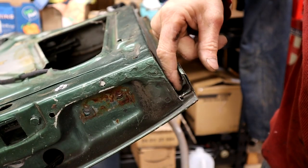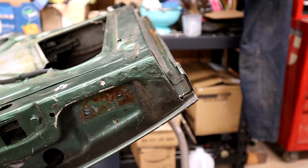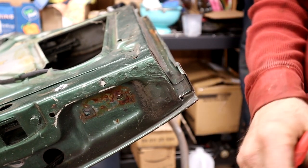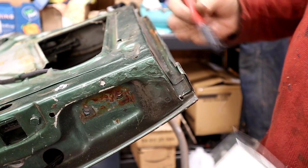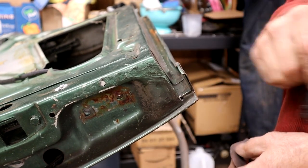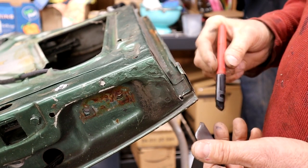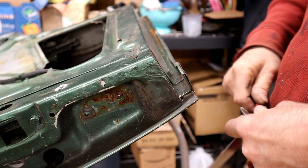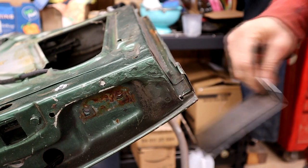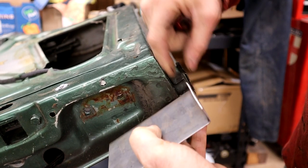So then, next one we got is this one going back up again, you see. Very similar approach to woodworking patches. You don't want to go chopping out all your metal until you've made your patch. Luckily, we've got this door to compare to. But even then, you want to get your patch as close as possible before you go chopping metal out. Well, that's the way I would do it anyway, so...